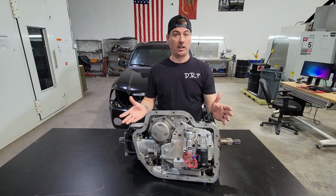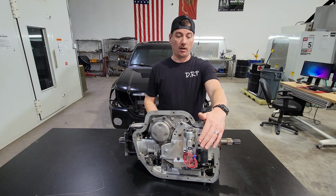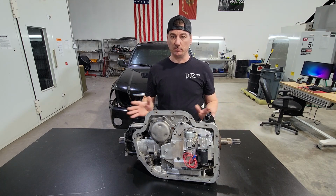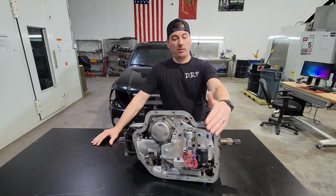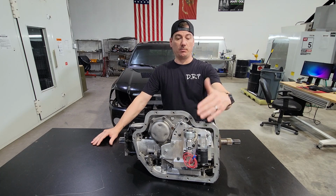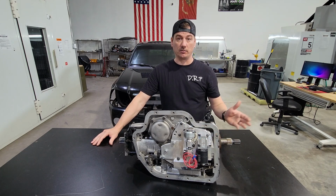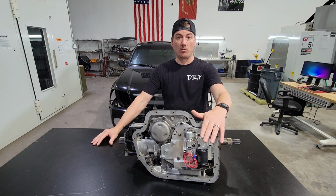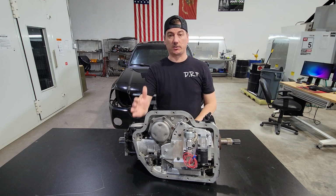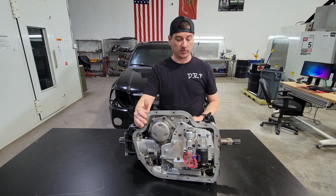Normally open is a safe thing to do, because if you have any failure in electronics and this is a normally closed valve, then you're going to start your converter and burn it out in a matter of seconds. So now we have a normally open valve. Once the ECU sees the boost you tell it to, it then allows fluid to continue to flow into your converter, filling it. There's many different ways to do that, but it's far more efficient and safer in your transmission than an external dump valve to create boost, or to help your engine create boost.